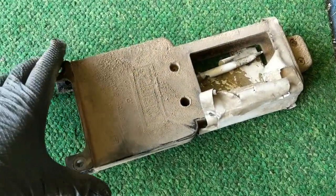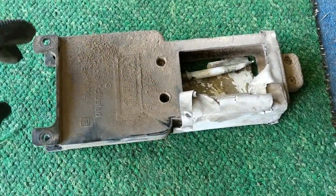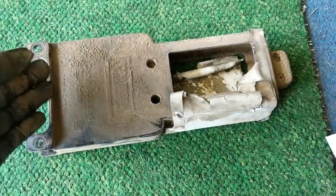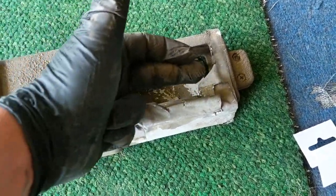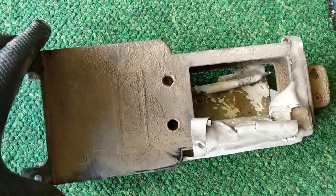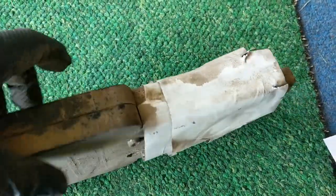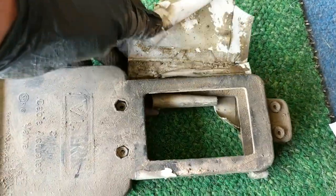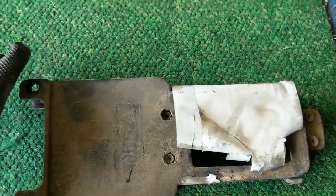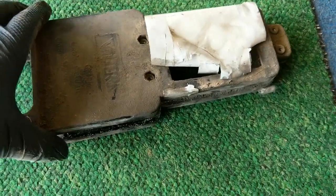Here's a better look at the cable pull assembly. Your blade valve would be right here — that rod sits in here and the cable actuates the rod up and down. Obviously you can see it's really dirty; it's been under the trailer a long time. That tape has been open because I unsuccessfully tried to manually operate the valve. So we're going to give this a good cleaning and get it all put back together and taped up so it stays clean inside.